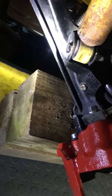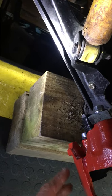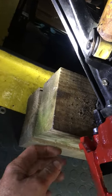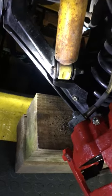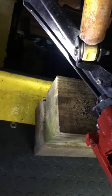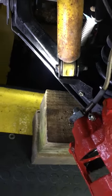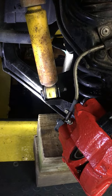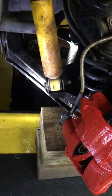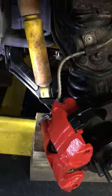Third, I added a bolt to the control arm — I drilled a hole, and there's a little stop on the bracket that hits the control arm normally. I added a bolt there to make it hit earlier, which limits steering slightly, but it's better than losing your brakes. I also simulated a worn brake pad — more than an eighth of an inch of wear — and it would still be hitting without that bolt.